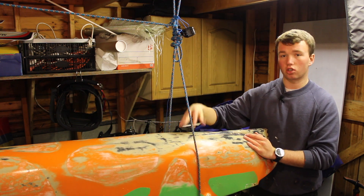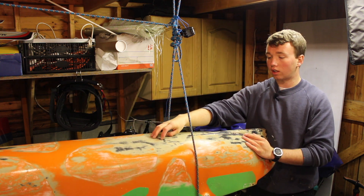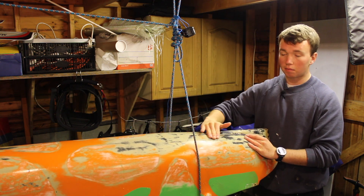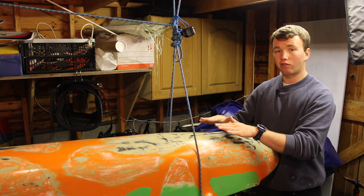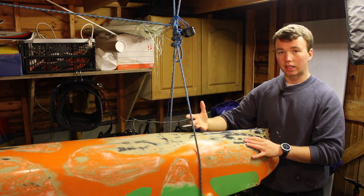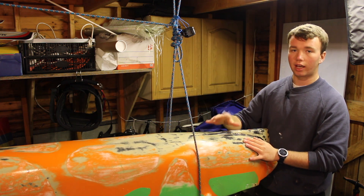Once sanded back, I can go up through the grades, keep sanding until I get a really nice smooth finish. Even though it's how it's going to look at the end, you can still see the scratches from the more abrasive papers, so as we go up the grades those scratches are going to disappear and it's going to become really smooth. The really important thing about sanding is that you need to take your time, because the finish on the boat once we finish sanding is the finish that's going to come through all the layers of paint. If we've got scratches and haven't polished it up properly, they're going to come through to the top coat and then we'll have to spend more time sanding back and polishing to get a really good finish.